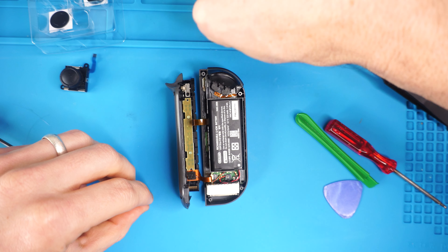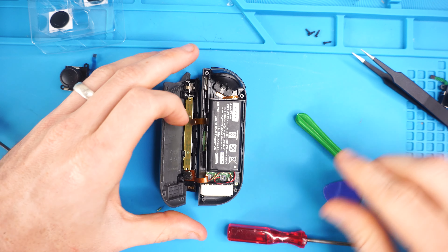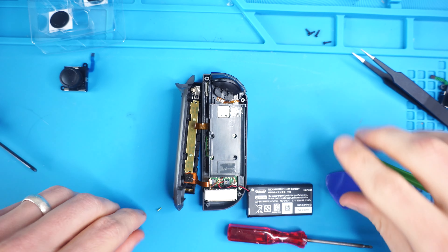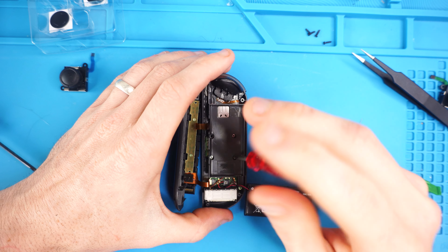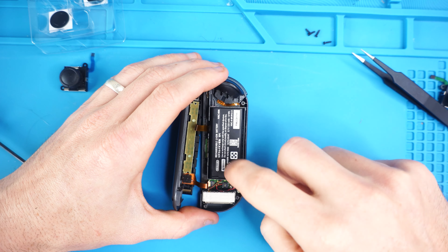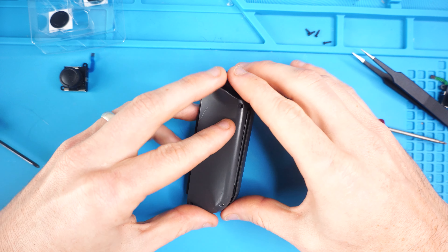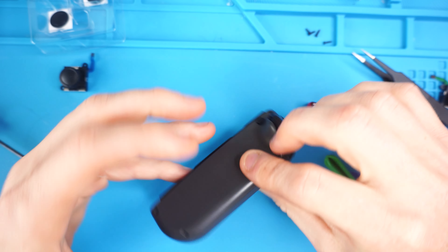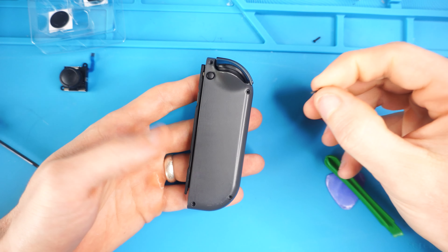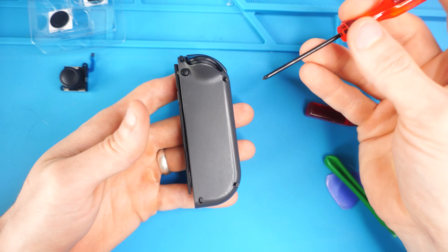Take the three golden screws and the Phillips head screwdriver and reinstall those three screws. Note that two of the screws are underneath the battery, so pry the battery back off, move it out of the way, install those two screws, then put the battery back with the negative side facing up. Rotate this side of the controller back on — it should sit pretty flush with no cables in the way. If it's not flush, something wasn't put together correctly, so open it back up. Put the four tri-wing screws back in, switching to the tri-wing screwdriver to make sure you don't strip them.